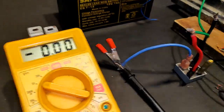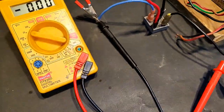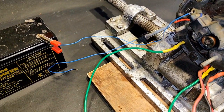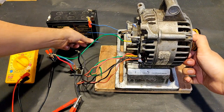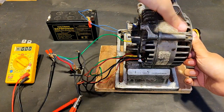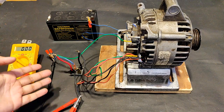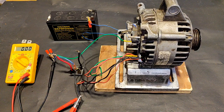I've connected the rectifier and the terminals of the meter, which is now pointing towards 20 volts DC mode. The brushes and rotor system have not yet been excited — I'll connect the wires. I wound the thread and connected the blue terminal to the rotor winding. The result was 11.5 volts DC — a little voltage drop due to forward biasing of around 1.4 volts.